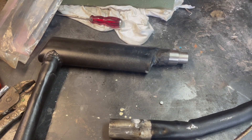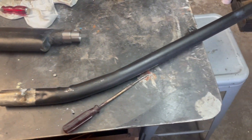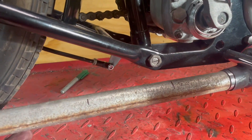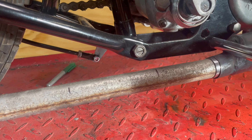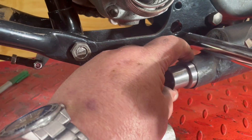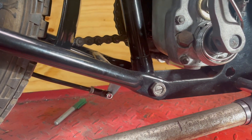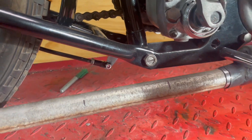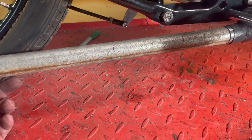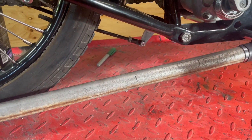Actually I might offer it all up to the bike and see if I can bend the tailpipe. At this stage I really haven't done a lot of damage — not a lot to lose — I'll persevere. It's going okay. The slip-fit sleeve goes in and I can use this to put on a little angle to start the bend of the exhaust. It goes back over there and I think with a few short slits and a decent clamp it'll tighten up. You can see a mark on the pipe where I think the bend needs to begin and where it needs to end. I need this angle smoothly put into the pipe.